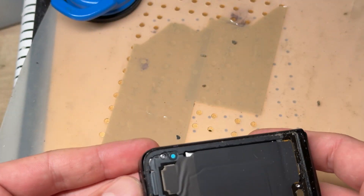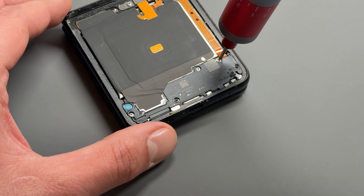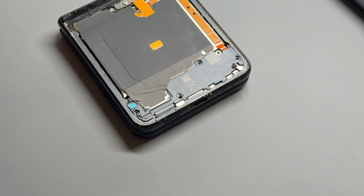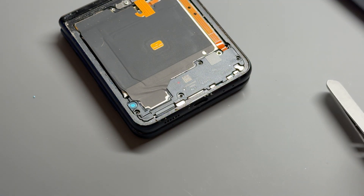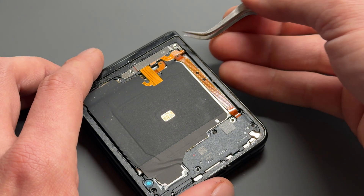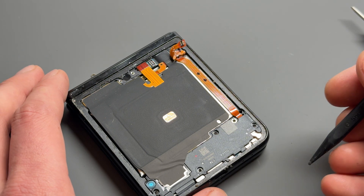Let's take this over to the workbench now where we'll swap the charging port itself out. So now that we're into the phone, we've got five cross-head screws to remove what's holding down this plastic cover on the back. I'm going to use the electric screwdriver for this — I'll leave a link for that in the description below. Just remember that one of these screws is a little black one that goes here. It is also a good idea to lift up this bracket because we want to disconnect the battery to isolate power from the device before we go playing around with any of these connectors. Use a plastic spudger to disconnect it, and that means the phone is now going to be turned off whilst we do this repair.